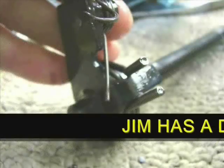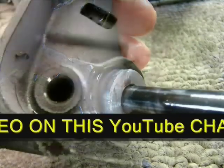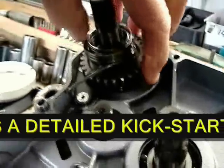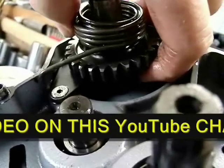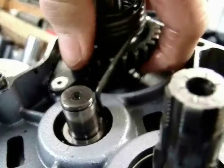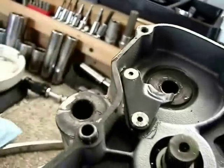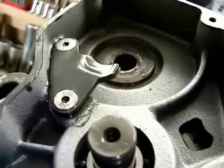We remove the kickstart idle gear, then pull out the shifting shaft. Then we take off the kickstart — you need to reach your finger around behind there and grip it as you rotate it counterclockwise to release the little thumb from underneath that plate. You need to hold this together so that bottom piece doesn't fall off and you lose your indexing, which is your spring return preload controlling the kickstart pedal return.